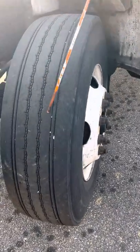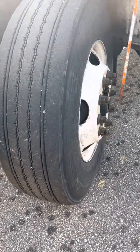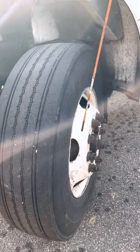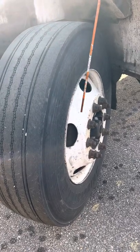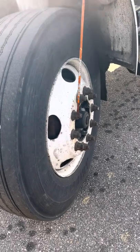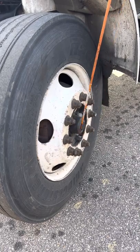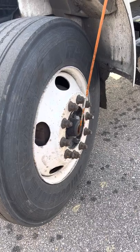You need to check the depth of the tire — 4/32. Make sure the tire is not ripped up, no damage, no cut on the tire, and proper air inflation. This right here is the rim — no dent, bend, crack, or illegally welded. This is a lug nut — no missing, no loose, no rust, no shine. You have the hub seal — make sure proper oil level, and you need to check all the bolts, make sure they are not missing; it has to be present, and also no sign of oil leak.